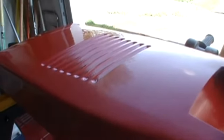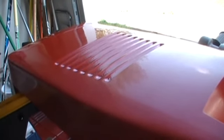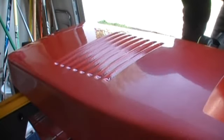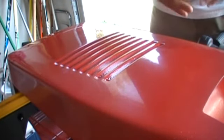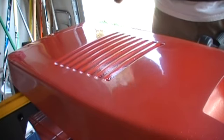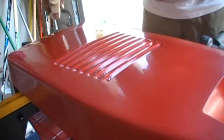That's probably a good angle right there. You can see the glossy, and you can see it's dull — so that's the part I just did. That's what buffing does. You can do it by hand, you don't need any special tools. The special thing you need is the cleaner — this is just a polish, it's not a wax. It's just a polish. It's got very fine abrasives in it, and those abrasives — as you rub them in, the crystals will break down and they cut right into the surface of the paint, smoothing it out.